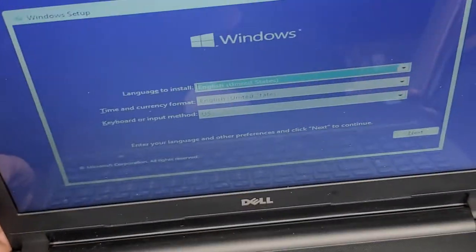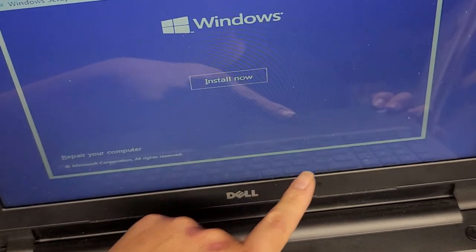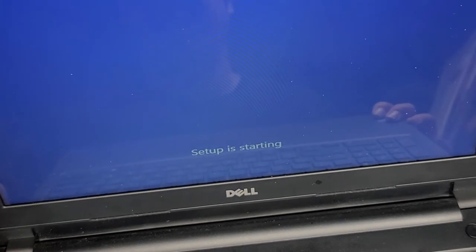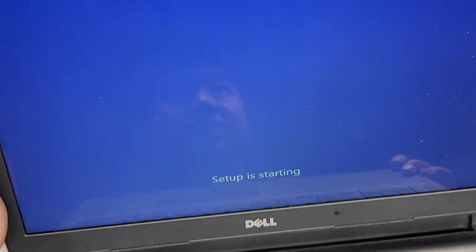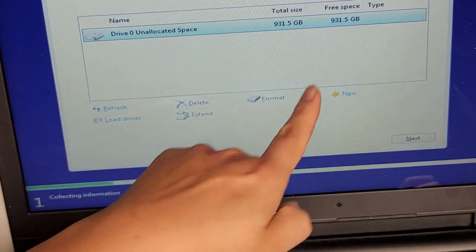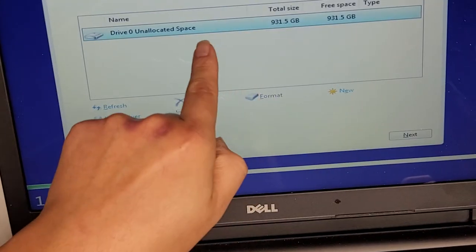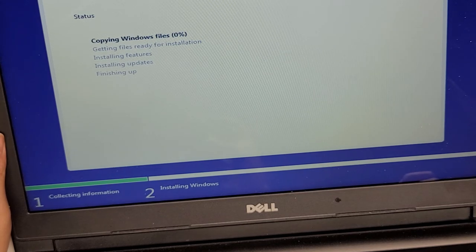You can also double-check the CD drive is working — push the button and you can see it popped out. That's pretty much all there is. I'll go through what I normally do: I press Tab three times, press Enter to go to next, Enter to install now, then do the custom setup to make sure there are no partitions on the drive. It's brand new so it should be completely unallocated. I press Enter and it will automatically create the partitions it needs. After that, it goes through creating your account and all those things.